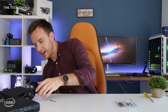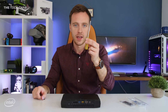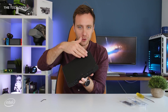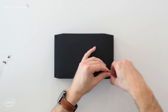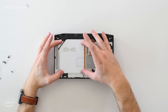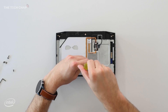Let's put the box and power brick to one side and actually open this thing up. You'll need two things: the Allen key that comes in the box, and a Philips head screwdriver — any one, it doesn't come in the box but I'm sure you've got one lying around. To start with we need to take off this top plate, which has that awesome little devil's skull that we'll see light up when we plug it in. We need to use the Allen key on these six screws. Then we can lift off the top plate. You can already see the cutout for the eyes of that devil's skull, which is going to look really cool when it's lit up. There are just two more little things to do — first, unscrew this one little screw here, and that's where the Philips head screwdriver comes in handy.